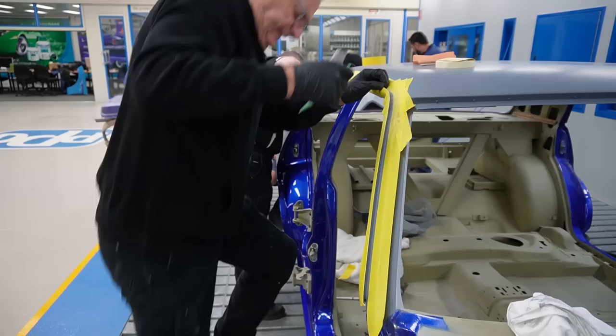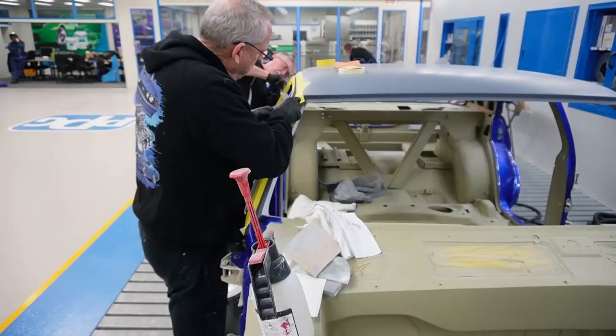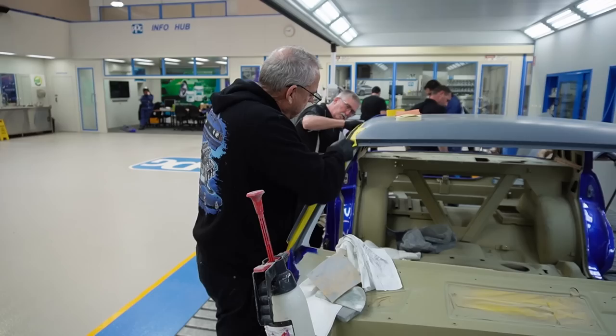It's just a sealer. Yeah, so it's a sandable sealer. So we put that in. It goes hard, and then you can sand it. Versus a urethane, once it's in, you're stuck with whatever finish you've got. So we're just finalising that and getting that sorted.